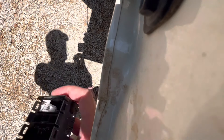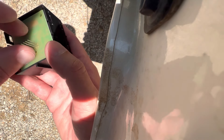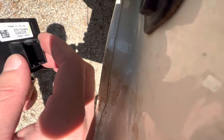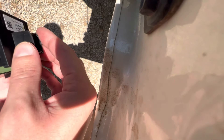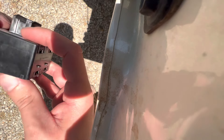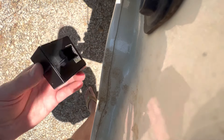Now set it back down and piece this thing back together. I've got the front of the housing and circuit board — that sits in here just like so, and the back panel goes on. Make sure you get those pins lined up from the back. You can see it's got a notch in the corner so the pins line up good. Now just set it on the back, click this together — module's back together. Maybe I won't have to buy a new one. Buttons feel about the same as they were.